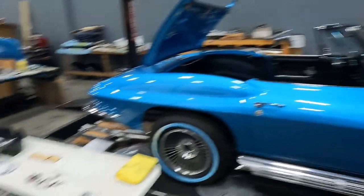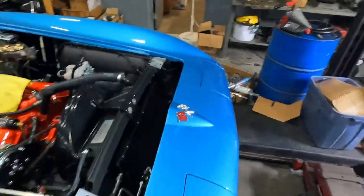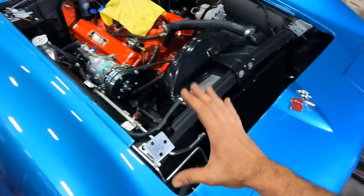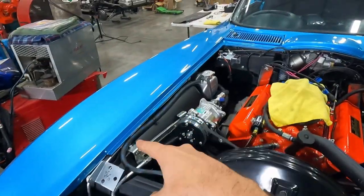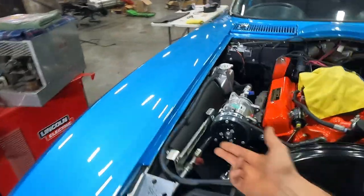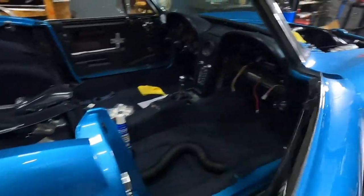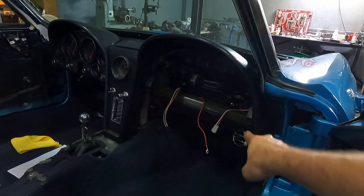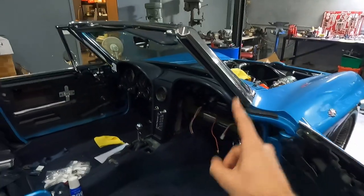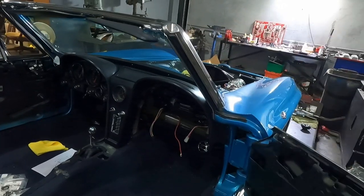I'm not going to walk right past this because last time I showed you, I had the Vintage Air kit here on the table. As you can see, I've made some pretty considerable progress with that. Condenser is in, dryer is in, the lines are in — those lines just fit so nice. Good job, Vintage Air. You guys know how I am about making sure everything fits nice and tidy. You can't even see that metal line — I hid it behind the bypass here. Compressor is in, belts are on. The evaporator unit is mounted in here, lower vent, defroster vent is in there. Definitely making some progress on the Vintage Air.